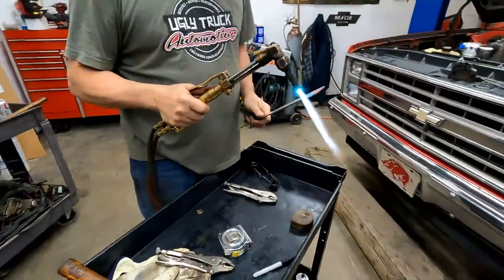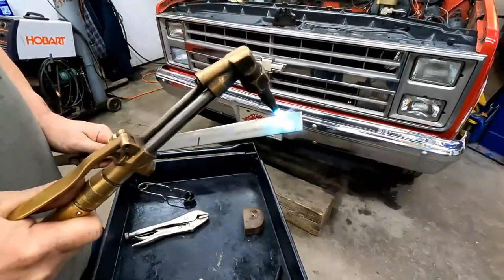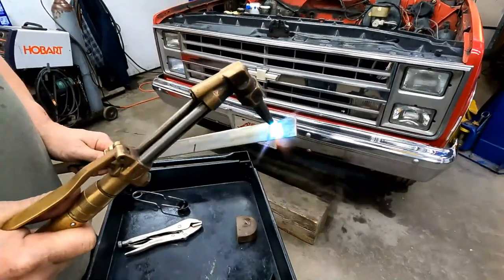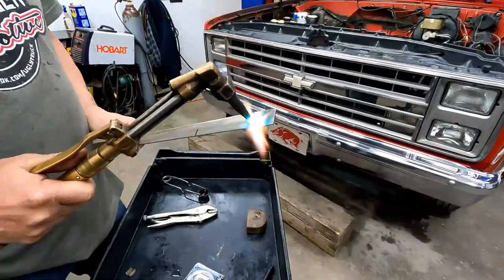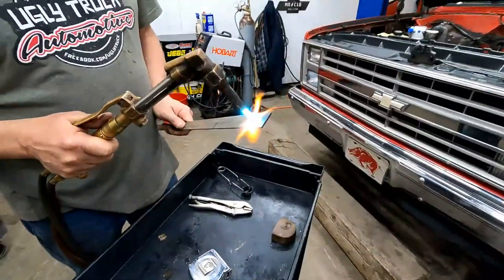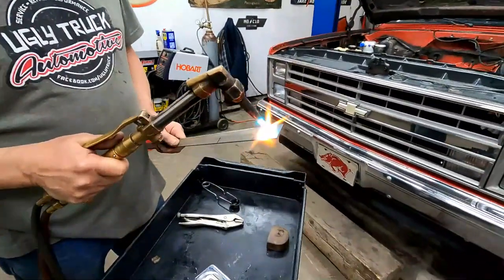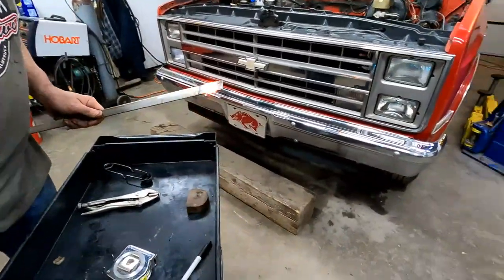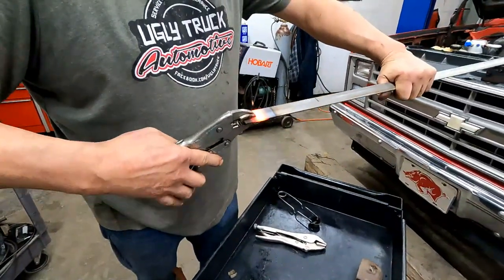All right, so I'm gonna heat this baby up red hot. If you didn't have a torch, you could do it by putting it in a vise basically, bend it over, hammer it over. It'll probably maybe even look a little nicer. This stuff bends pretty easy. I'm gonna use a vise grip. Not a sponsor.